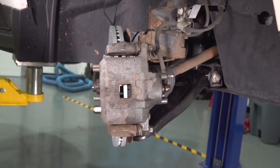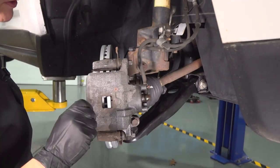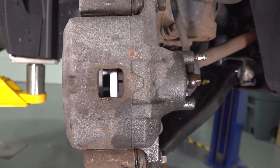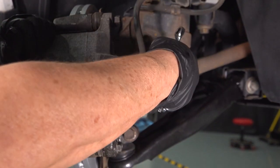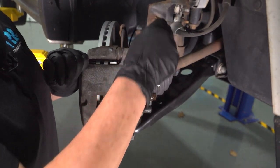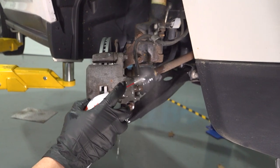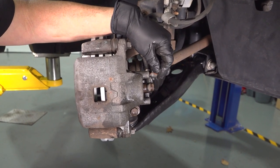The last thing I like to do is pump up the brakes — physically go in and push the brakes, make that piston come out, fill up the cylinder with fluid, and then I will open that bleeder screw and let it gravity bleed. Make sure no air bubbles come out, then close it. So now I've pumped it up — I'm just going to open that bleeder screw and let it gravity bleed into my bucket. After a minute or two, snug it up, and always install that rubber boot again. If you don't have one, find something that keeps the dirt out of that bleeder.